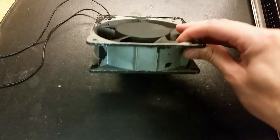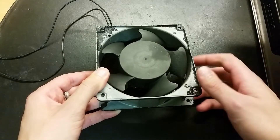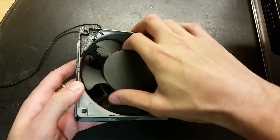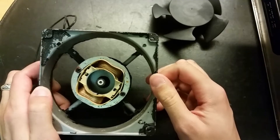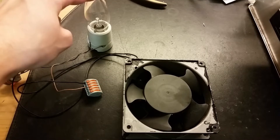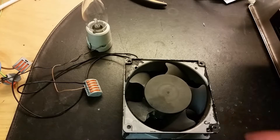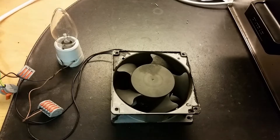Now I've washed the fan and the paint just fell off. I've used a pretty corrosive detergent in this cleaner. I removed the little lock ring on the back so I can remove the actual fan — there's the squirrel cage and the coils. They don't look so bad. Let's plug in the fan — I have a light bulb in series with it. Nothing happens. So maybe the fan just shorted out and opened the circuit. Let's do a full autopsy and see what the problem is.